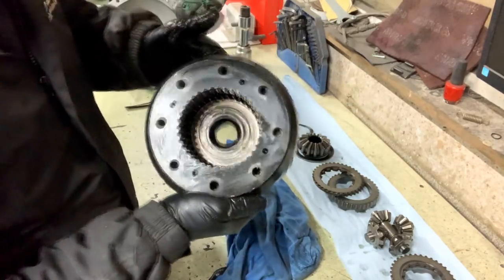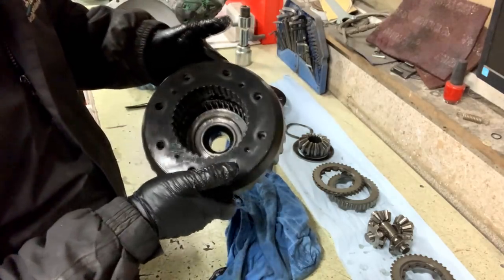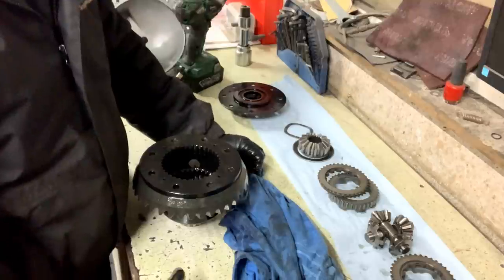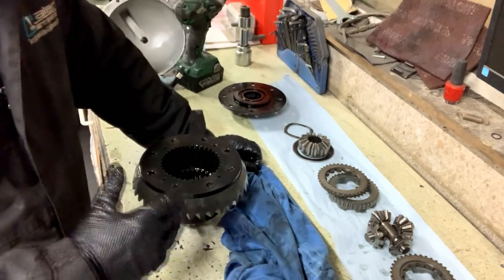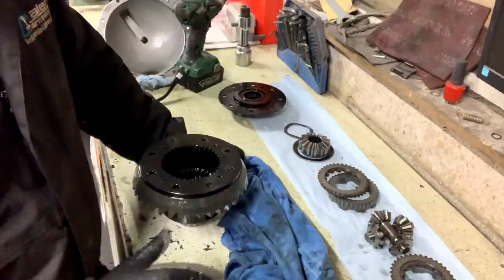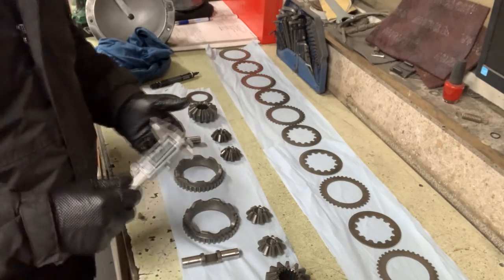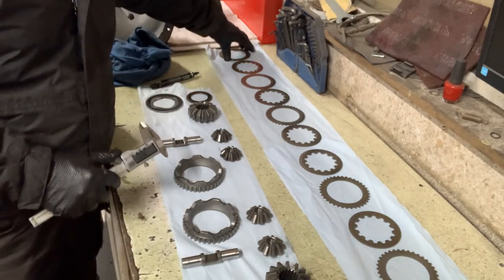So that gives us an empty diff housing. There's a spacer down there that just sits in the bottom - it's just a locating thing. It doesn't have to come out; it doesn't have any wear or tear issues. So I'll give all this a bit of a wash and clean and then we'll get ready to start measuring up our plates - see what we've got in there at the minute and then we can work out what we want to put back in. The building of this is going to be a trial and error with different sized plates to see what torque we get - we could assemble this 5, 10, or 30 times. It'll all depend on how quickly we get the recipe of plates to get the preload that we want. So I'm going to do some measuring - just with a digital vernier, which is accurate enough for this - just to get an idea of what we have to start with.